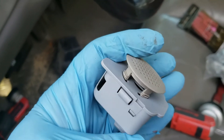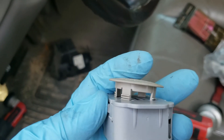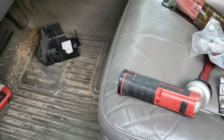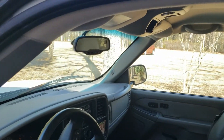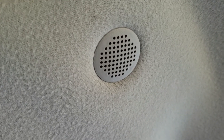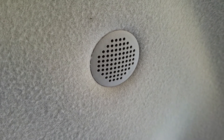This is the way that grill snaps in — those little teeth fit in the slots and that's what holds everything firmly in place. The sensor right there is the interior air temperature sensor, also called an aspirator. The sensor is back behind it, above the headliner. I took it out, cleaned it, and put it back in, because I didn't see anything particularly wrong with it other than it was dirty.